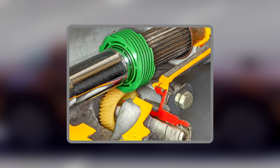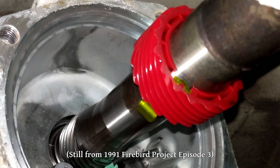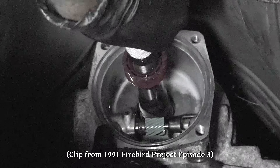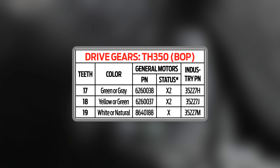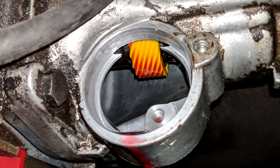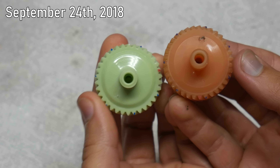The lowest driven gear tooth count that exists is 34. While I'd like the speedometer to be accurate, I don't need it badly enough to remove the tail shaft from the transmission to swap the drive gear — that's retained by a clip and is relatively simple once the tail shaft housing is out. If we were replacing the drive gear, we'd want a white 19-tooth, since plugging 19 teeth into the same equation gives almost exactly 34. Ideally you'd want the reading to be slightly high rather than low, to help stay out of trouble with speed cameras — but with our tire, transmission, and axle ratio combination, that doesn't seem achievable.